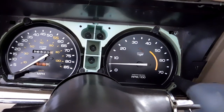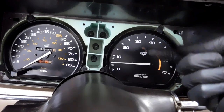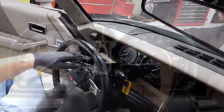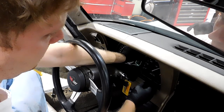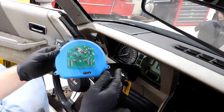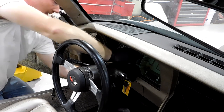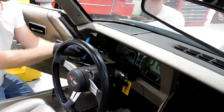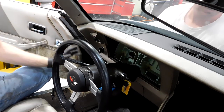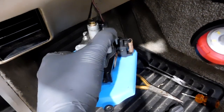To do that, get a quarter-inch socket — there are three bolts on each one of these. The tach will just pop out. The speedometer, you have to reach up behind the dash and press the clip that holds the speedometer cable to the speedometer, and then it will pop out. The tach kind of just pops right out — it has prongs that attach to little prongs inside the car. This one has cruise control so it has a little cable on it — you can just hang it down and release the cable right there.